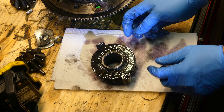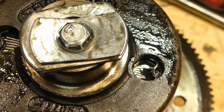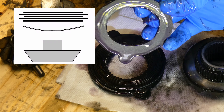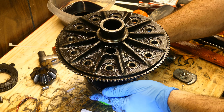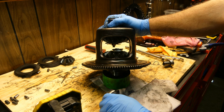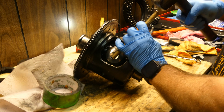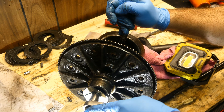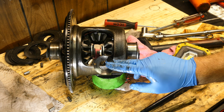Using oil or grease will help everything stick in place. Then feed the assembly into the differential and make sure the clips align with the holes on either side. Secure it with the bolt and washers. Make sure the clips are visible. Same thing for the other gear — concave side towards the discs, bowl side up. Secure with new clips, feed into the differential, and bolt it down. The spider gear reassembly is probably the worst part of this whole job — you've got to align the gears on both sides and somehow drive or spin them in together. Using a brass punch was the only way I could get them in, as spinning by hand with new clutches was quite difficult. Just go slow, make sure they're moving at the same time, and they need to be oriented exactly 180 degrees from each other when finished.